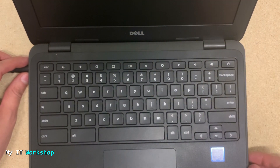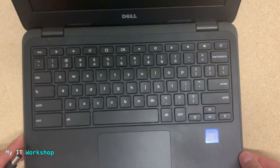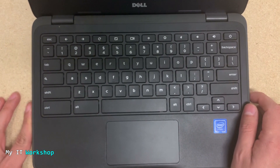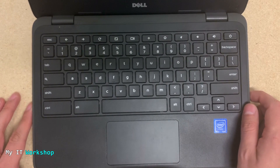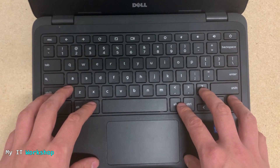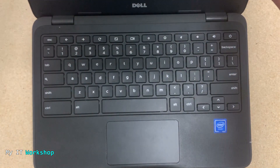I'm going to shut it down — you can see the light there. After a few seconds I disconnect it from the charger. The next step is to press the power button for around 15 seconds; nothing happened. It's obviously something going on with the battery, so we have to turn it around and remove the case.